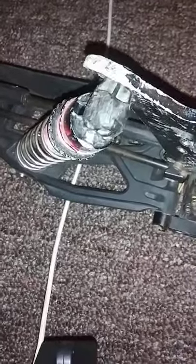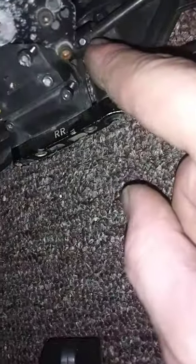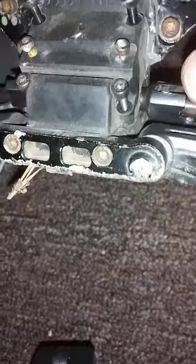The RPM stuff will flex so bad that your arms, or these, can bend. They can pop out. They'll flex so much that it'll stress this and bow it open a lot, and it can actually break these off. That's not a common thing, but RPM can cause this right here to flare, because it bends past its travel limit.